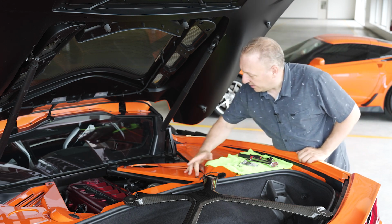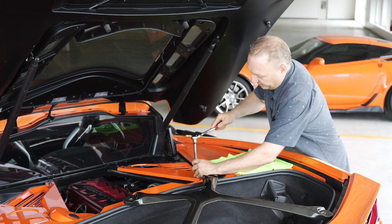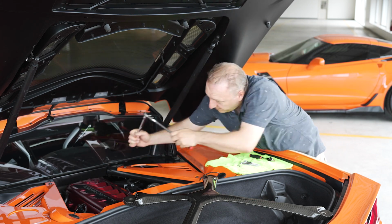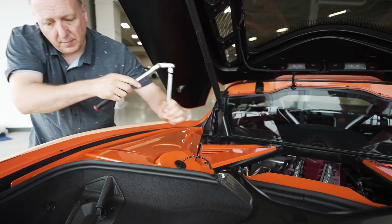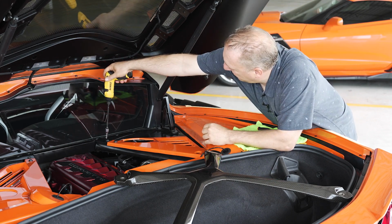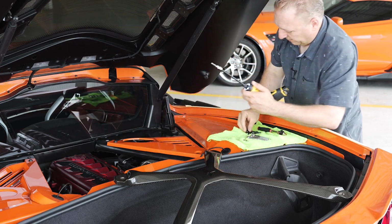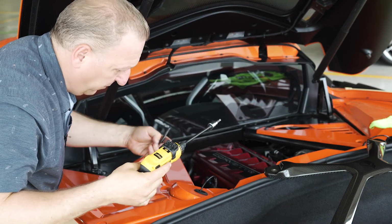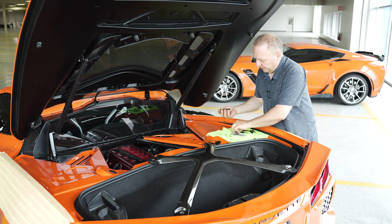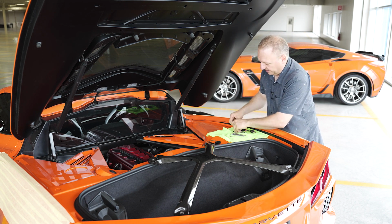Installation is very simple. I'm removing 2 T40 bolts, the rearmost of the engine appearance, and the one near the glass. So break them loose. Since we're reinstalling new bolts, I won't be needing these, but I will be saving them. We'll notice the new bolts are longer to compensate for the bushing in the X-brace.